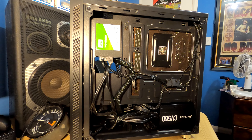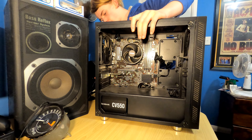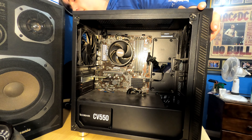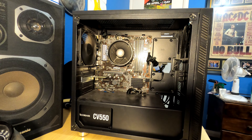I don't like being overly confident, so I'll leave the back and front panels off just at the start. We'll get the computer set up on the desk. Testing a power supply is simple unlike other components — you just check: does it turn on or not? So flip the switch — nothing should happen when you flip the switch — and then press power. Three, two, one — and there we go. The power supply works. Very glad the dead power supply test was properly confirmed.